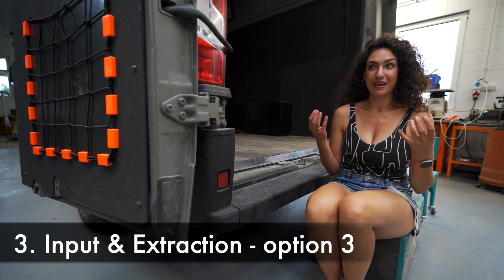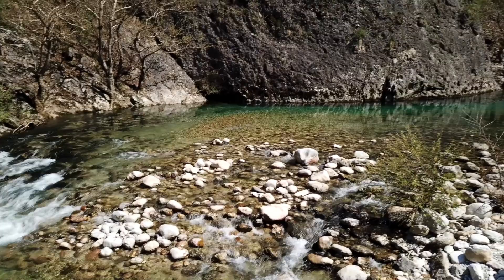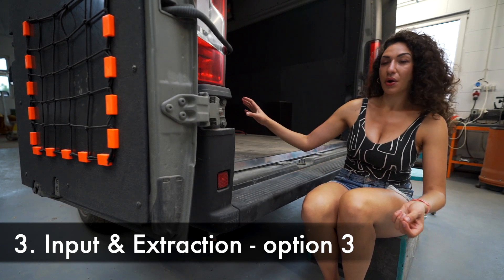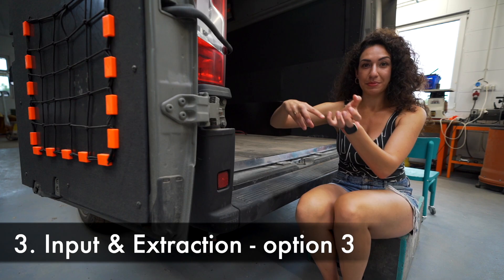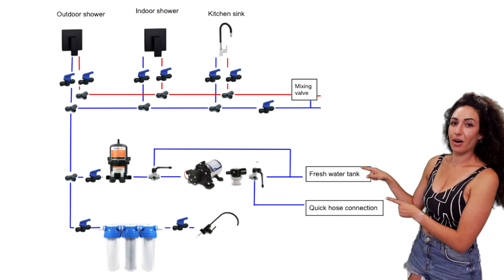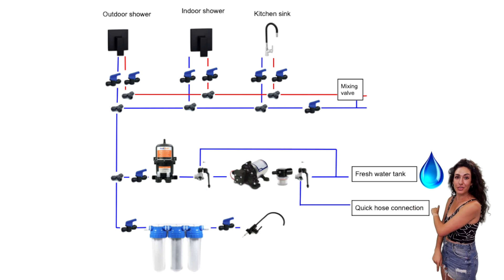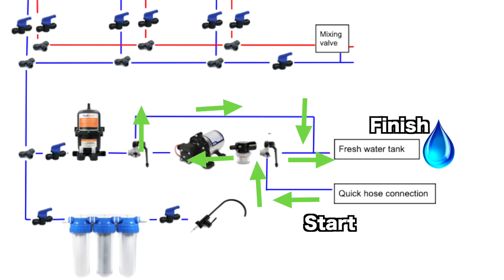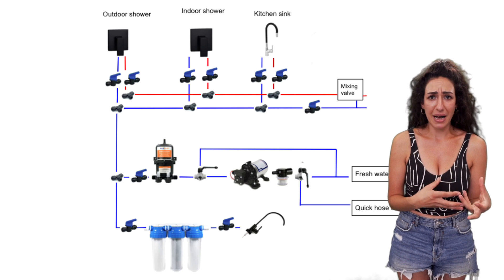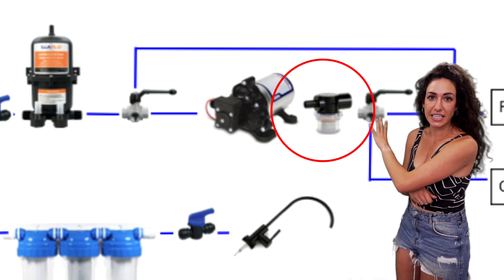The other thing we really wanted was a way to use natural water sources. We once found an incredible creek and wanted to use that water for dishes and everything else. With this same quick connect feature, we'll have a hose with a filter on the end that we can set in the creek and use our water pump to suck water from the creek into the tank. We change this handle and the water pump will suck directly from the quick connection hose and deliver water to our fresh water tank. The hose filter will stop larger debris, and it also passes through our smaller filter before entering the system.